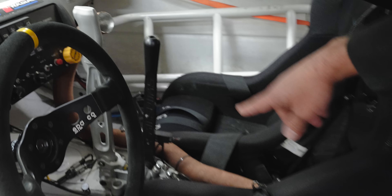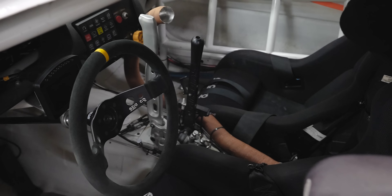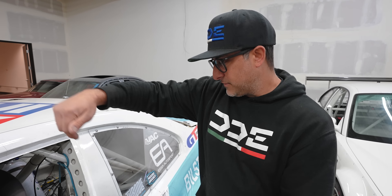That part is sorted, but now we've got to do the e-brake. In this car, we've got an e-brake with a single master cylinder and it's a pass-through system. What that means is we're not doing a separate set of calipers just for the e-brake. This one is a combination — whether you're using the foot brake or the e-brake, both are going to the same calipers. It's all four all the time: from the master cylinder, through the brake line to the rear, it gets interrupted by the brake lever, then splits off a tee to the two calipers.